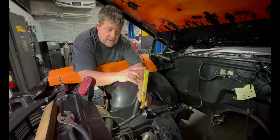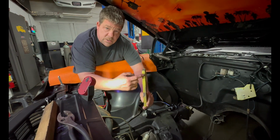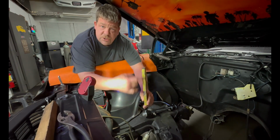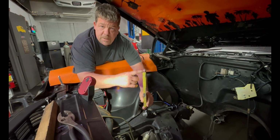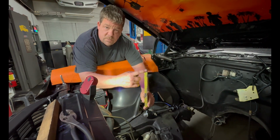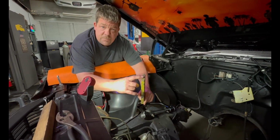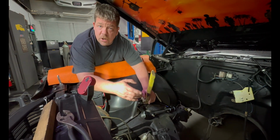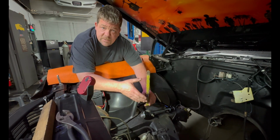Now when you adjust caster, it's kind of the same thing. Think of the reference of the lower ball joint and the upper ball joint there, or a center line in the center. Now casters would be the top or the bottom of the tire. On most cases with the new McPherson struts, it's more of the reference of where the lower ball joint is. It'll actually be negative, which will be like if somebody hit a curb, the control arm everything gets pushed back. That's classified as negative caster.